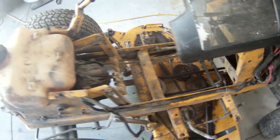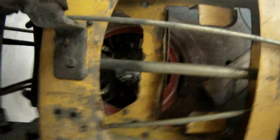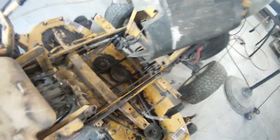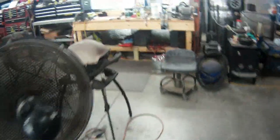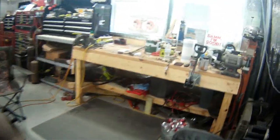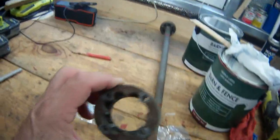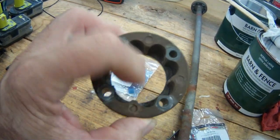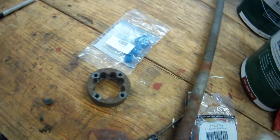There is no way to get to this drive shaft as it connects here to the hydrostat — it's going to go all the way inside there to attach to the engine. So it's quite a job. I'm going to get back to work here on the drive shaft and I'll try to film when I go to put these barrels back in. I've got to get my rotary file up and clean this where it was. That's the noise I was hearing when it puked out the barrels. There's no way this makes a connection.